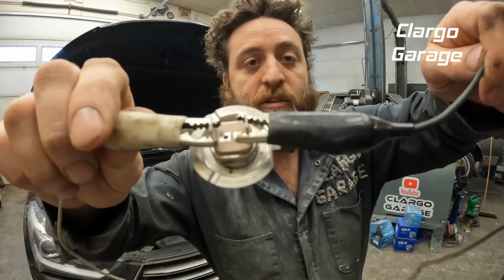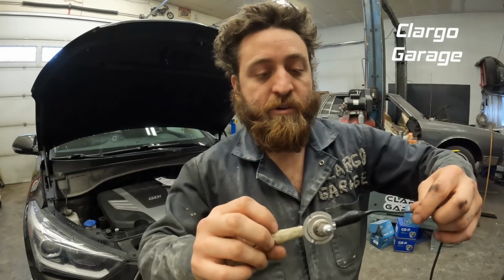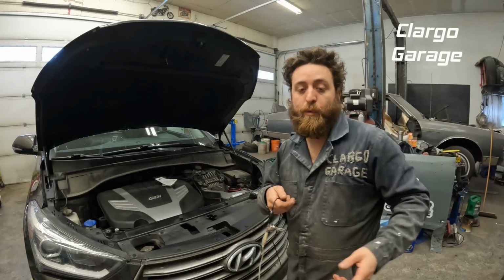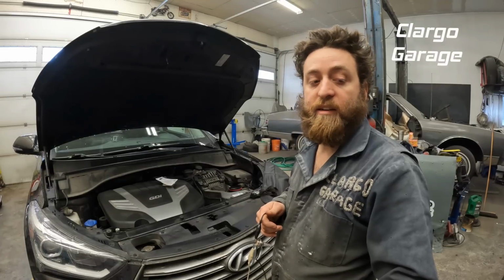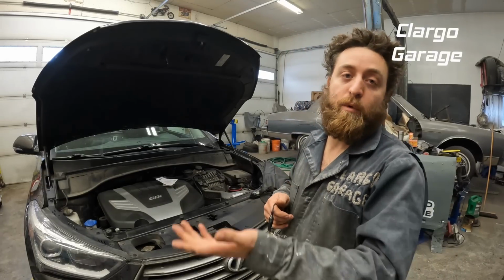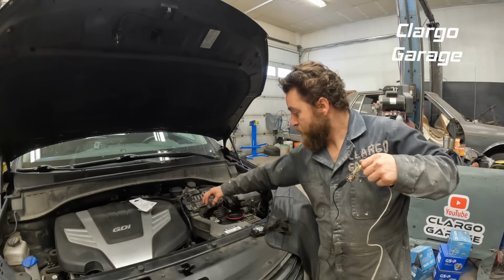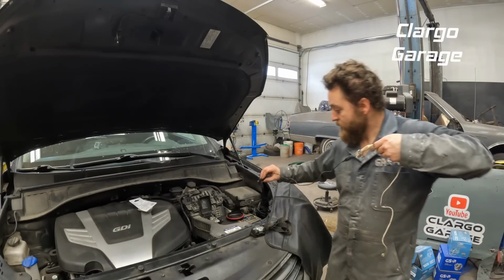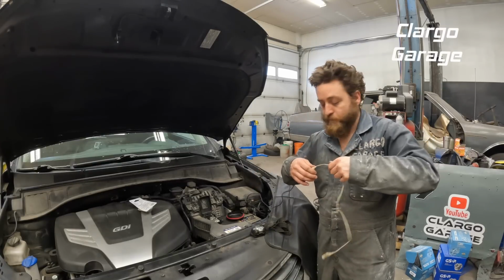In this case, I'm just going across it like that. Make sure the gator clips aren't grounded out or touching anything. Then we'll go over to our battery and put it on the negative and positive terminal and just verify that it does not work, or if it does work, then we jump in further. I'm just going to push up on the positive terminal so that exposes that. I'm going to clip onto the negative terminal first, the ground.